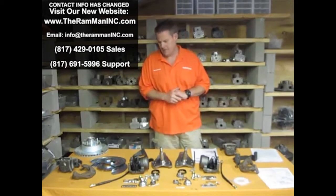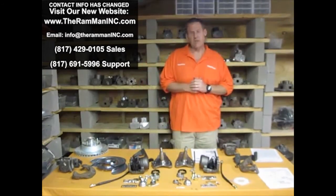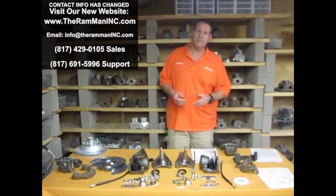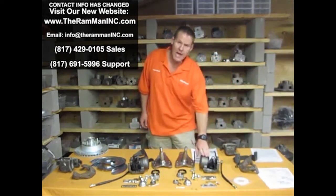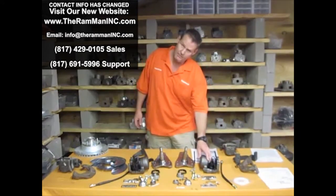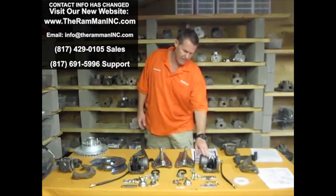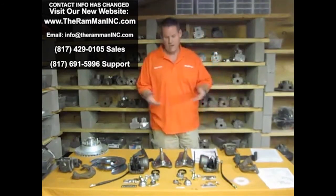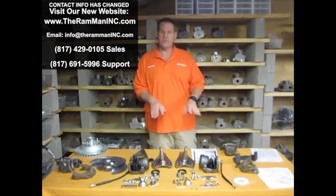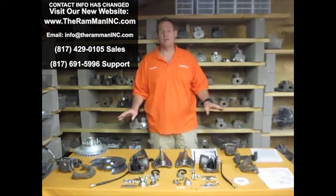At one point in time you could get all this stuff from the salvage yards, but that's been crushed and gone for a long time. Basically what we did was duplicate the 1976 A-body stuff. The reason we picked that specific year is because in '73, '74, and '75 A-body calipers, they came with smaller 2.6-inch pistons. All other Mopar cars had always used the bigger 2.75-inch piston, and finally in 1976 they went to the 2.75-inch pistons.